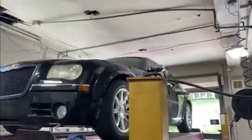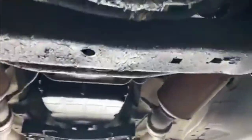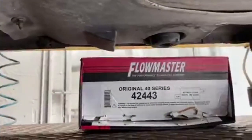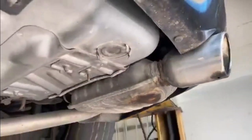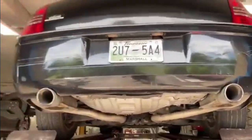We showed you the before — it's a 2005 Chrysler 300C. This is after. The two catalytic converters are still there, the factory X pipe is still there, two-and-a-quarter all the way back. We put two-and-a-quarter Flowmasters, part number 42443, if you guys want those — there's a link in the description. Look at those beauties, that's how you get them done clean and nice. We left the resonators on it; he'll bring it back probably in about a week to replace those.